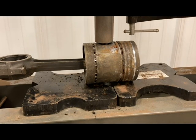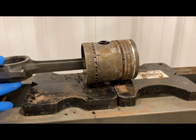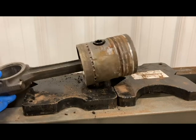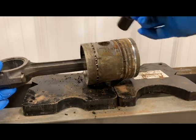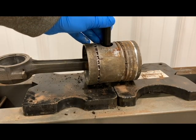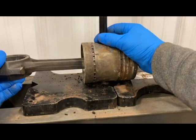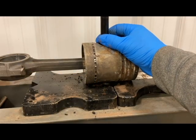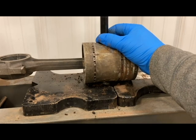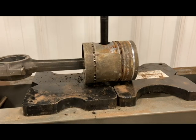All right, just push it down until it's about flush with the piston. We'll go ahead and lift this up — that should be about where I need to be. I'll pull that out, put my extension in here upside down. I need to go up just a smidgen. Same thing — line everything up. See right down there is the wrist pin; we'll put a little pressure on it. Now I'm just going to feel for when my connecting rod becomes loose.